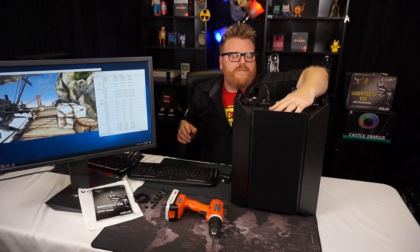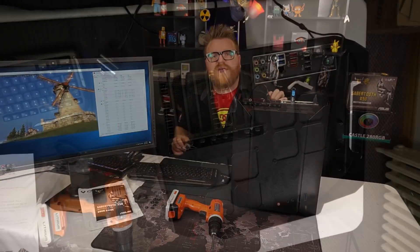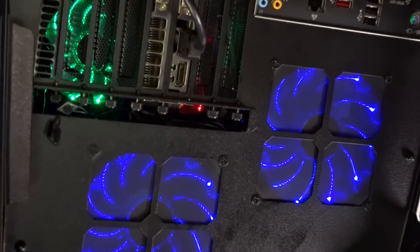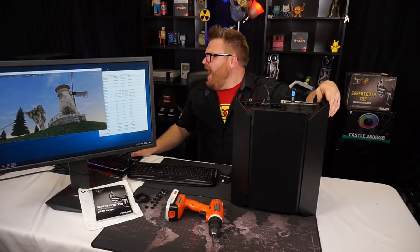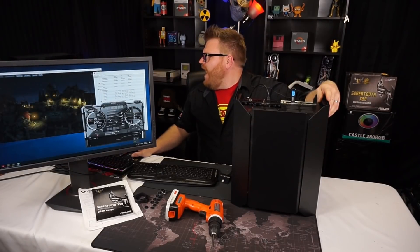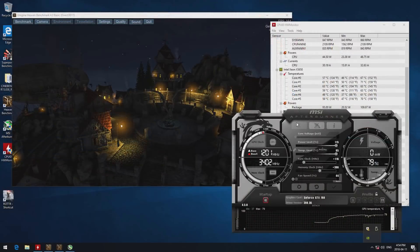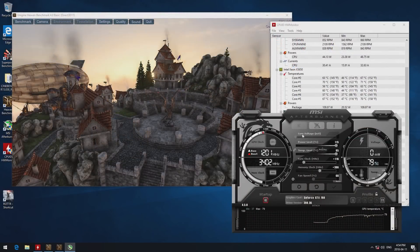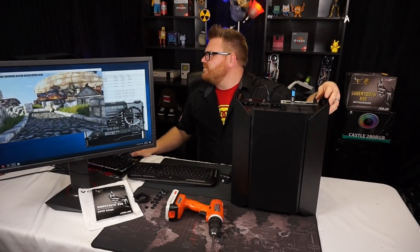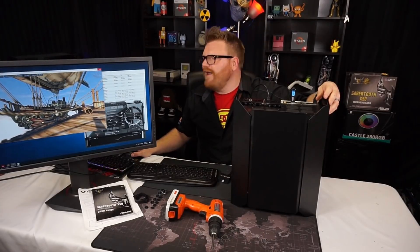The CPU is not that hot right now because I'm using these blue fans. The lights only come on when the CPU is under load — I've set Q-Fan control so there's not enough power getting to the fans until you really make the CPU work. I have the GPU overclocked in MSI Afterburner: 116 MHz on the core and almost 400 MHz on the memory for the GTX 760. I'd never played with it before, but it seems pretty good. If a 750 Ti is a really good budget option, this is even better, though it only has 2 gigs of memory. Over 120 frames per second in Unigine at 720p on high — that's not bad.